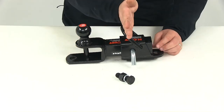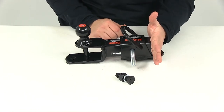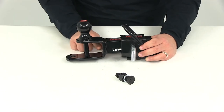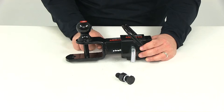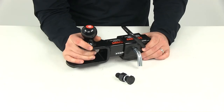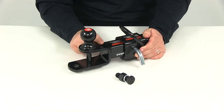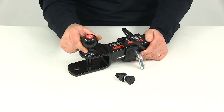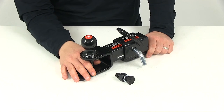The measurement from the center of the hitch pin hole to the back edge of the shank is going to measure 2½ inches. In this area right here you're going to have 1¾ of an inch of opening, going from this portion to this portion. This is going to offer about ¼ of an inch rise to get up to that ball platform, and again you're going to have the 2-inch ball diameter. Curt is going to cover this with a limited lifetime warranty.